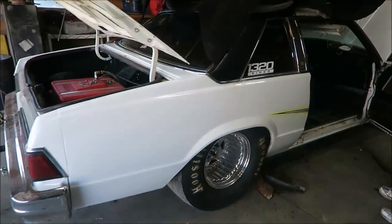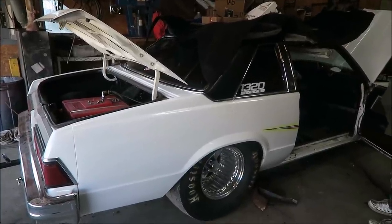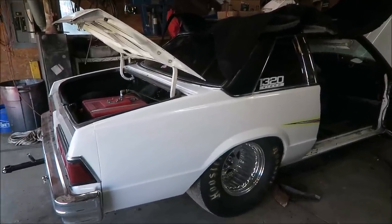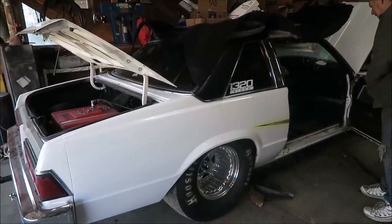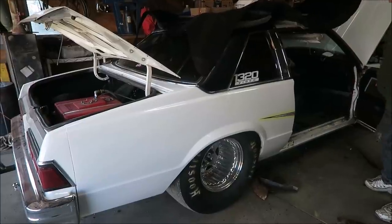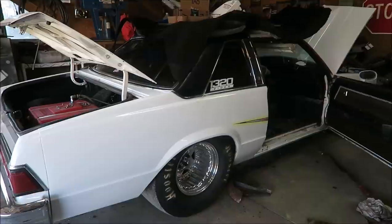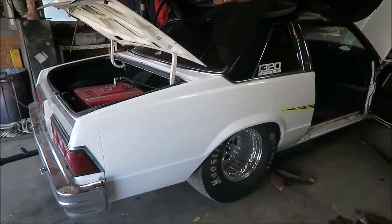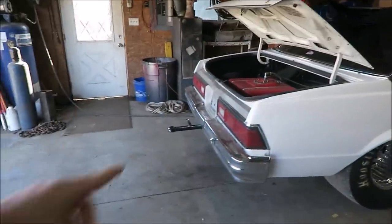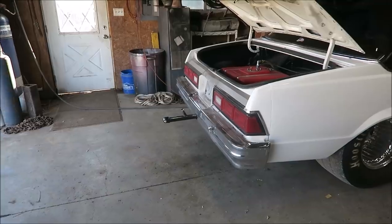Yeah, we gotta mess with the rear end a little bit. The four link geometry is just a little wonky. I think just a bar change and lengthen them so that it's square in there, and it'll be all right. And then make a beefier panhard bar. Redo the parachute mount so that it can come out and quit busting shins.